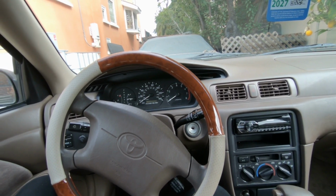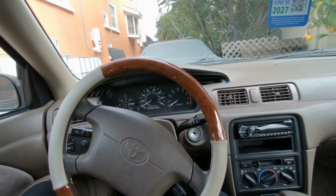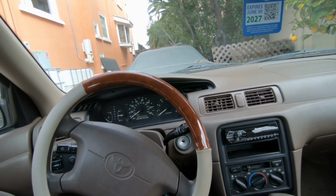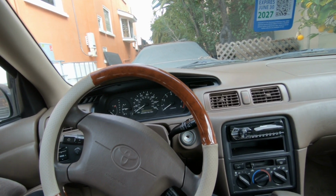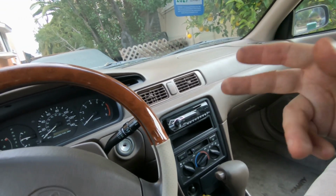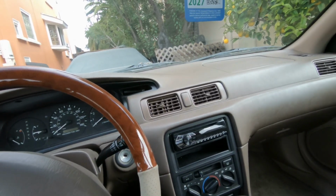It was like after it rained real hard. It was funny, I made that one video and the problems went away because I went to change the wheel cylinders on it. I had narrowed that down as a possible problem, since I'd seen people online doing the wheel cylinders and stuff. The knuckles get real bad, and there's a magnetic sensor in there. So it could still be the rear sensor.